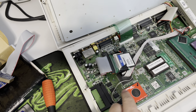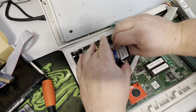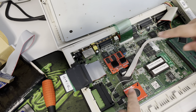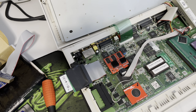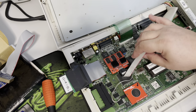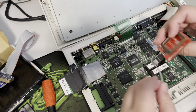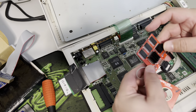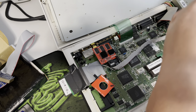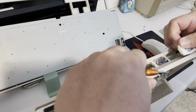Now we're inside and you can see the Scan Plus AGA and its goings-on, and my compact flash drive here that's so expertly installed with its electrical tape. The Scan Plus AGA has a ribbon cable that goes off to the little door on the side for the VGA, and I'll put the new one there too. It has chips that jump onto the Alice and then jump onto the Lisa chip. They make some scary noises coming off but actually they came on and off pretty well. I put these little heat sinks on there too. I'll need to remove the floppy as well because it's covering up the cable for the VGA output.